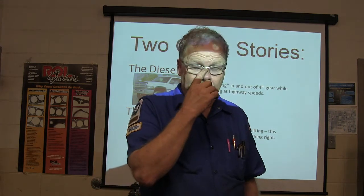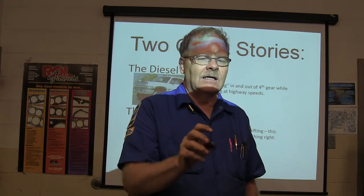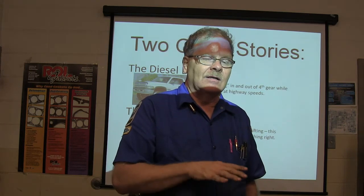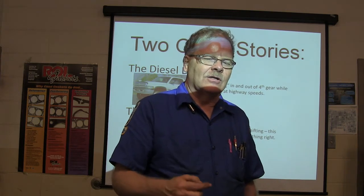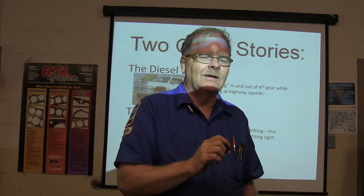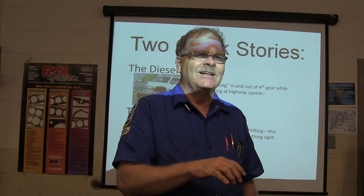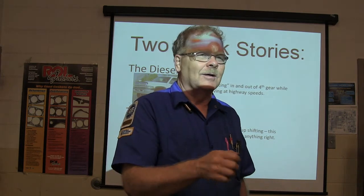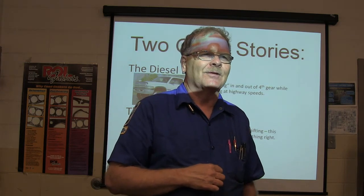So we researched it, and if it sees 12 volts coming through that four-wheel low bulb and it's not energized, then it assumes that it's in the high gear and it'll shift out later. But if the engine controller sees that there's no voltage coming through that four-wheel low bulb on the dash, then it puts it in four-wheel low shift strategy mode. And so we put a fuse in there and got those lights working again, and all he needed was a fuse to fix that whole problem.